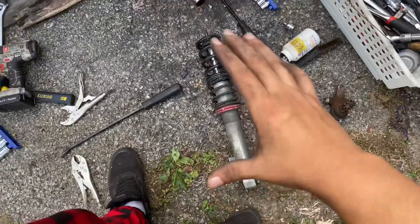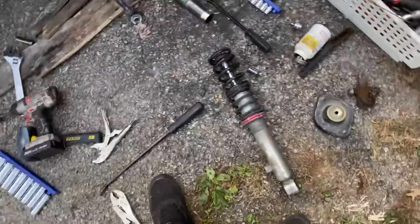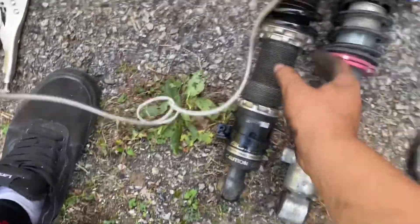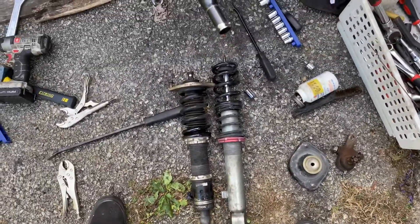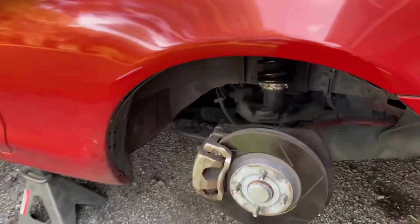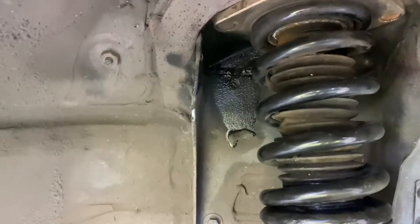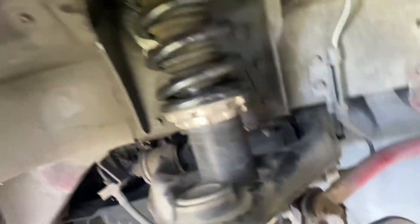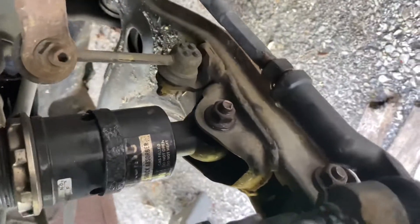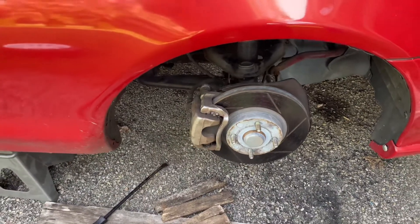This thing's just long. That spring doesn't compress too much and it's very soft. Got it out — what a nightmare. That one popped a lot easier. It's all in together. New anti-seize, I painted over there because it was a little scratched — I don't want it to rust. Put anti-seize on everything down there. New tie rod is on. I left it loose because I still need to do a little DIY alignment. Let's put the wheels on.